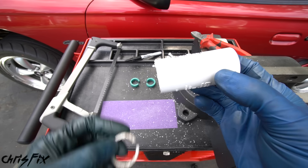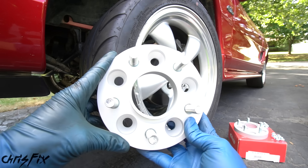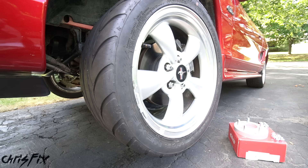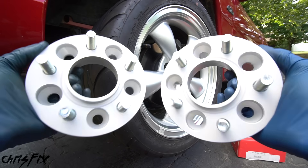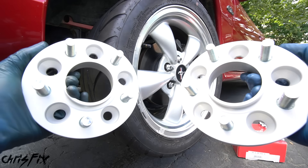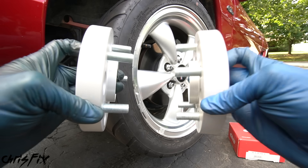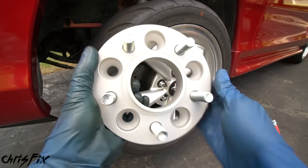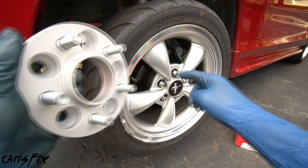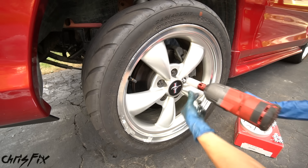What I want is a lot more angle than just a couple of degrees. So I'm going to run a quality set of 25mm hub-centric wheel adapters. These will move the wheel out enough to clear the suspension with no problems. I know there are a lot of questions, bad information, and misconceptions about wheel spacers and adapters — like how thick you can run them, whether they're safe for a daily driver, and if they'll wear out your bearings quicker. I will be making a dedicated video on that. For now, know that a high-quality hub-centric wheel spacer or adapter is perfectly safe and will give us the extra clearance needed for a lot more angle.